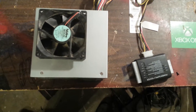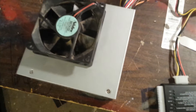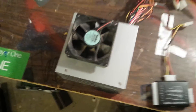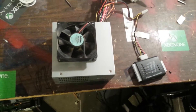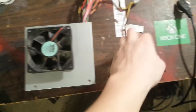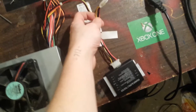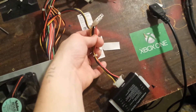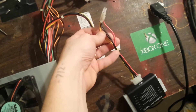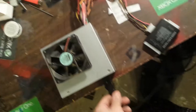Just a quick video on an internal power supply for a desktop computer. I plan on using it to power PlayStation 2 or Xbox 360 hard drives — basically anything that takes 5 or 12 volts. On your Molex cable, the yellow wire is 12 volt and red is 5 volt, with two grounds for each. We'll go ahead and plug it in.